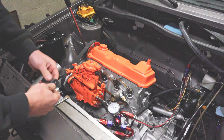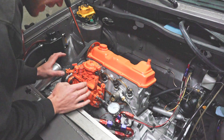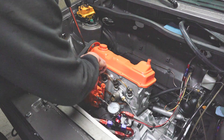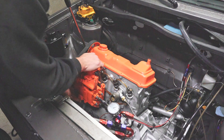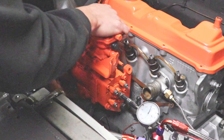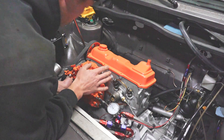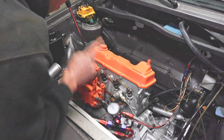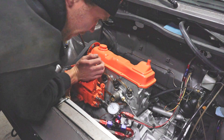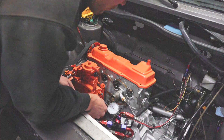Now I'll loosen the pump up a bit and adjust it to get closer to our target of 0.0385 inches. I think all the timing pump bolts are just snug except one I tightened a lot, so I'll loosen them a decent amount. Quick pro tip: when I installed my fuel pump I greased all contact points and sanded down any extra paint to make this adjustment process easier and smoother. You can watch the timing decrease — this isn't an official measurement yet, we'll have to recheck by moving the engine backwards and forwards again. We're at 0.0357 and I want 0.0385, so let's get right there.